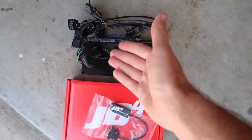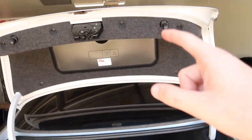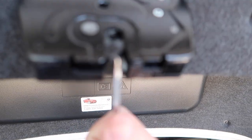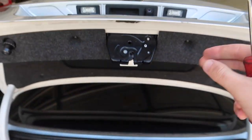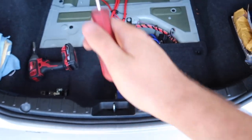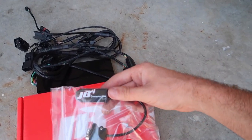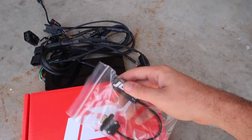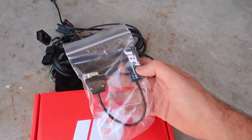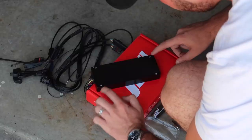We're going to remove this trunk piece because we need to disconnect the battery — better safe than sorry. I loosened the 10-millimeter and pulled the negative out, so now there's no power to the car. Make sure you don't close the trunk: grab a flathead and just lock it so it will not close. Once you connect the battery and unlock the trunk it will release again. Now, since I ordered the wireless kit, let's take apart the JB4 and install the wireless card to it. First, move the JB4 over and remove these four screws.